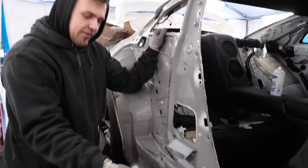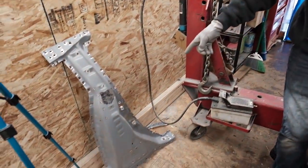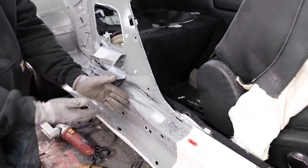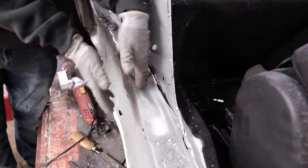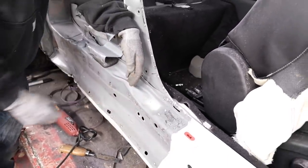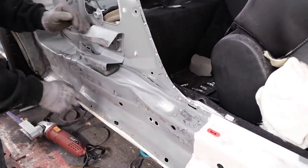What I'm saying is that we discovered more damage, and go ahead and imagine this. So imagine we were pulling this piece out. So we grabbed something and we're pulling it. It's really hard for us to pull two different pieces of metal at the same time. If we're pulling that one, it's just gonna rip it on the spot weld. So that's why we had to uncover all this, that way we can see this.